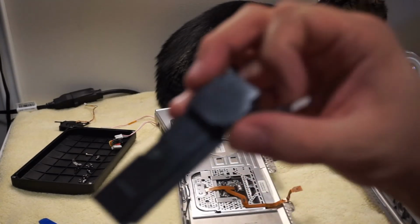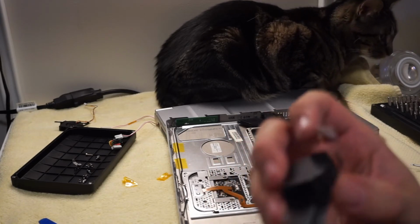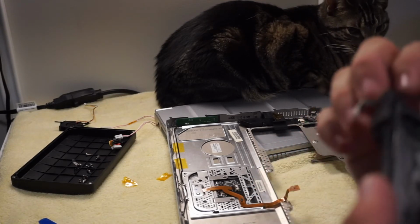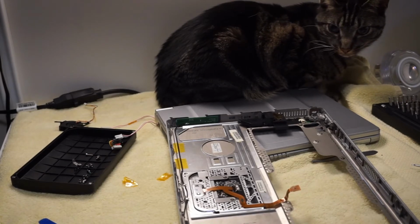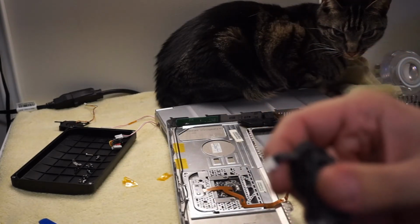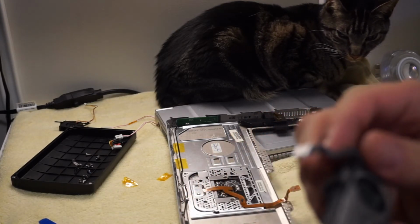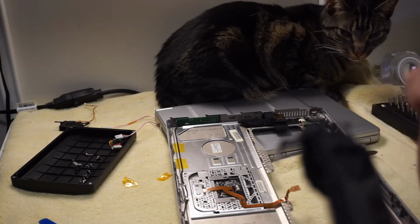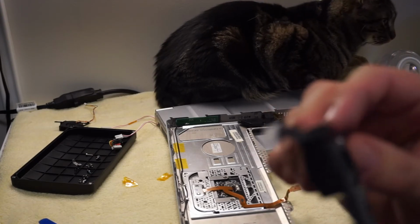And then the question is, why on my other system am I not getting any sound? I don't get it. I mean, this seems like such a simple component that I just dropped on the floor. Such a simple component, right? We have literally a connector with 6 wires going into it, 3 grounds, 3 signals, 1 to the microphone, 1 to left, 1 to right. Oh, you know what I should do? I should test the microphone on the TiBook and see if that works.